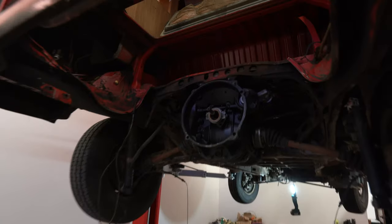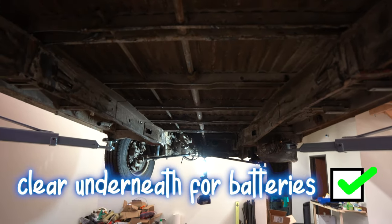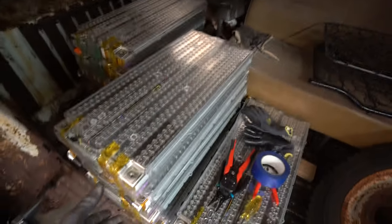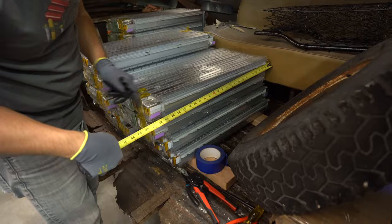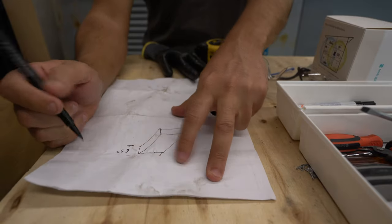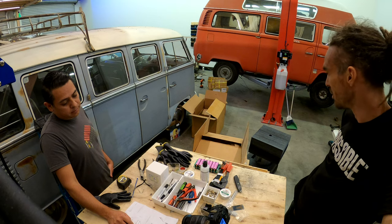I've cleared as much as I possibly can. Here's where the engine's been removed, the fuel tank, and this centre section is where I've taken all the piping and cables. I think we're ready to measure up. We're going to build the boxes out of cardboard and put them in place just to double check. Then we're going to take those measurements, order in the aluminium sheeting, and build the boxes. These are the Tesla batteries that are going inside — there are 14. Let's do 28 spaces so we have room to run a cable. Six and a half inches by 12 inches, 28 batteries.